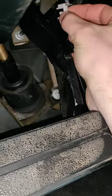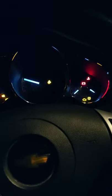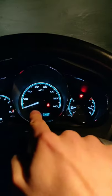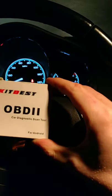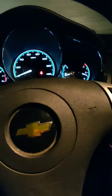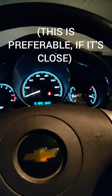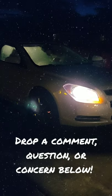The tab is back in position, so finish installing it. Let's go ahead and start her up. Great — you can see that the check engine light went off and there are no errors displaying. What we did have to do in between was buy a car diagnostic scan tool off Amazon for about seven dollars, plug it in underneath the steering wheel, and using your phone you can clear the codes. You can also go to AutoZone or anywhere else and they'll clear it for you for free. Thanks so much for watching — drop a like if the video was helpful. Have a good one!